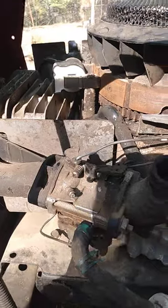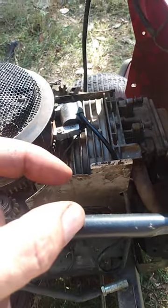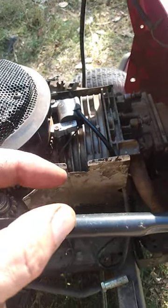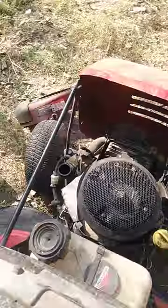It's almost running. We tested to make sure we're getting good spark — just took the spark plug off and grounded it off this little gap to make sure it was working consistently and strong. It was consistent, so I'm going to give it another try and see what we got.